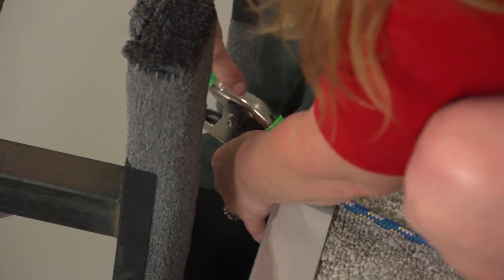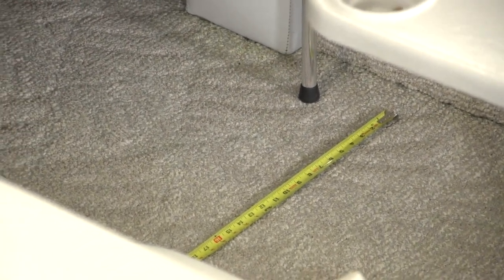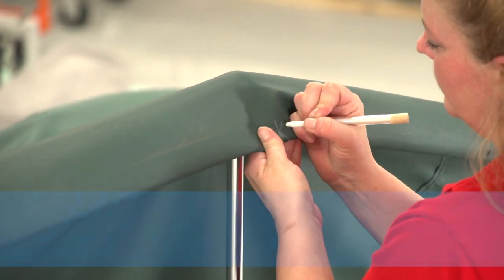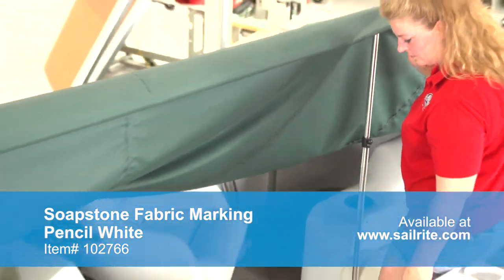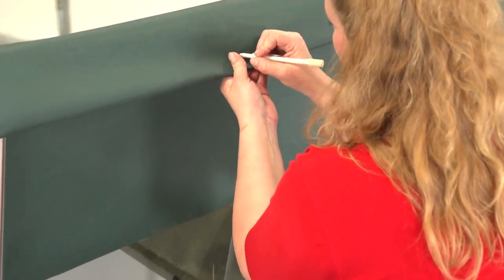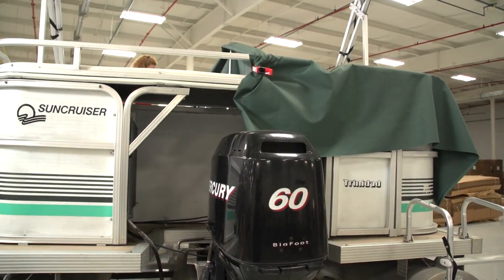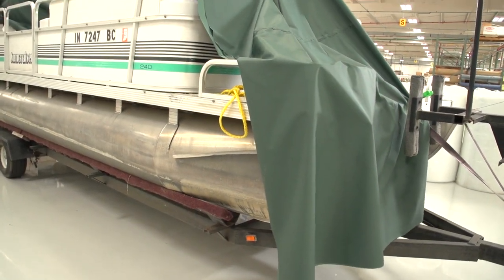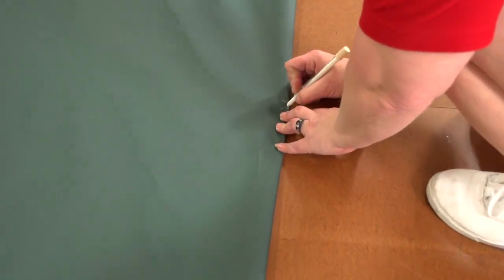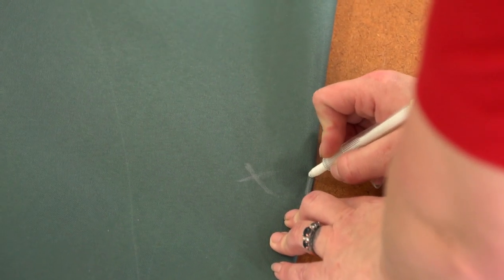Angela is laying a tape measure down the center line of the boat. Since she has not spaced the support poles out evenly she will use the tape measure to determine where the pole will actually be positioned on the fabric. Where she wants the pole she will mark the location on the underside of the fabric with a soapstone pencil. Do not worry about where the center is from port to starboard because we will determine that at the loft table by folding the fabric in half. Just be sure you have enough fabric at the aft and the bow to cover the snaps and still include a double hem. Lay the cover on the floor and fold it in half to find the center, with outside surfaces facing each other. Find your marks for each support pole and make a new mark at the new center location. Do that for all the support poles.